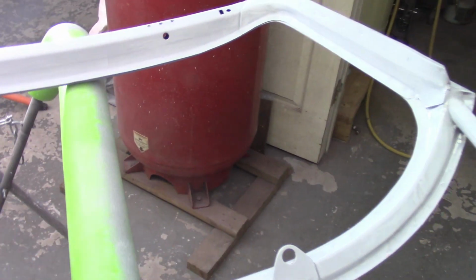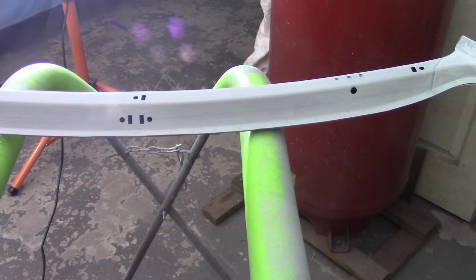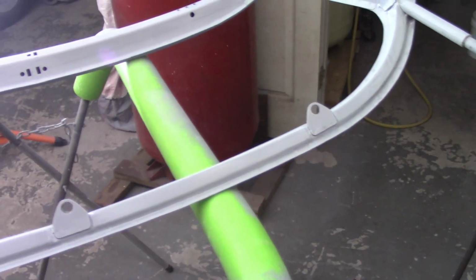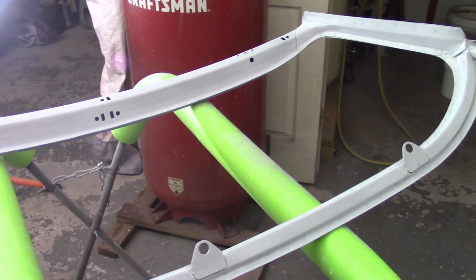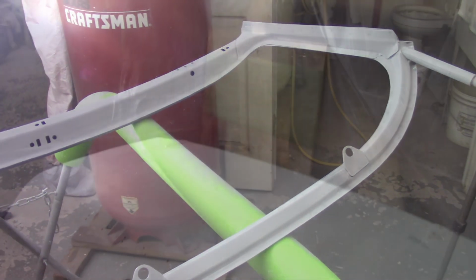Also, this entire side of the windscreen here on the inside will get completely covered in the vinyl. I showed you when I took that off forever ago. Who knows if I'll be able to get that stuff back on successfully or not, and how that stuff is held up. Again, another thing where I'll have to heat it up a little bit. But anyway, it's been sanded to 220 grit. It's been wiped down with wax and grease remover. I'm going to hang it up in the booth, get it situated in there, and be ready for shooting some paint.